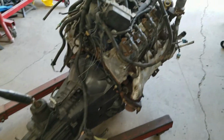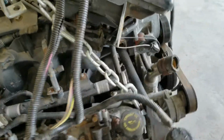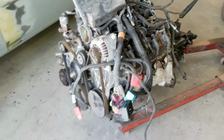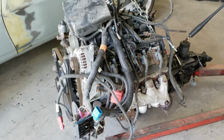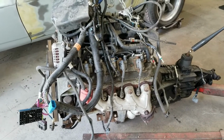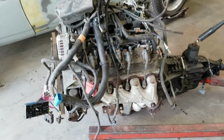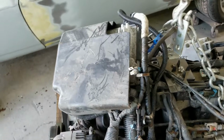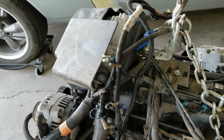So like I said, this thing's a little too tall as is, so this low RPM torque truck intake ain't gonna work. But I did already buy an LS7 cam. It's supposed to drop right in here, give me a bunch more lift, bunch more duration. The short stroke of this 4.8 should sing pretty nice, and it's not going to be too crazy. I can still control it with the stock PCM and tune that with my phone and TunerPro like I did with the truck.